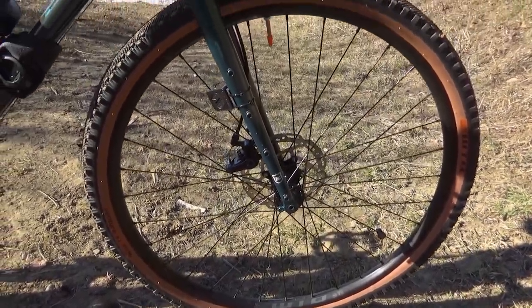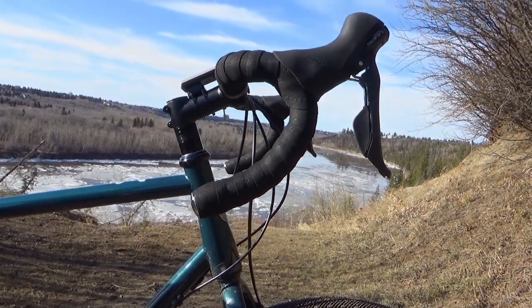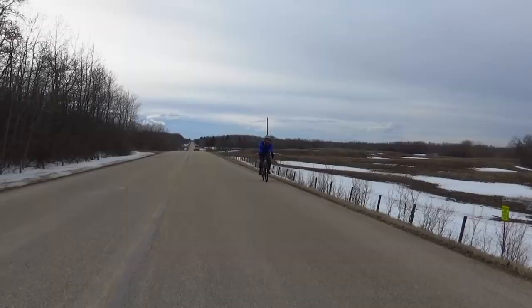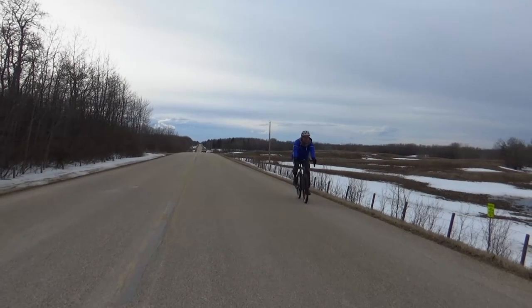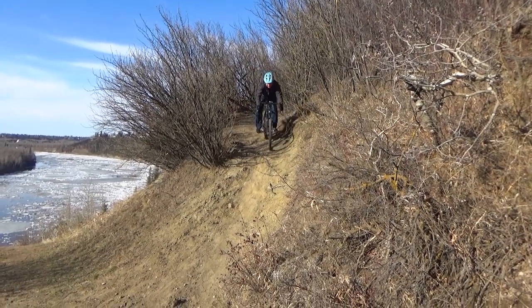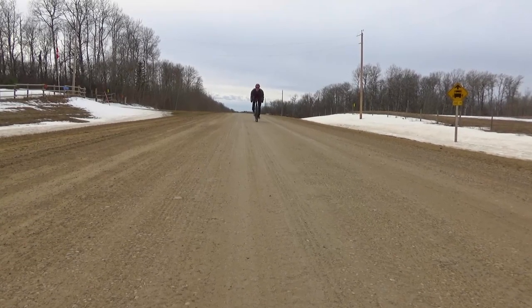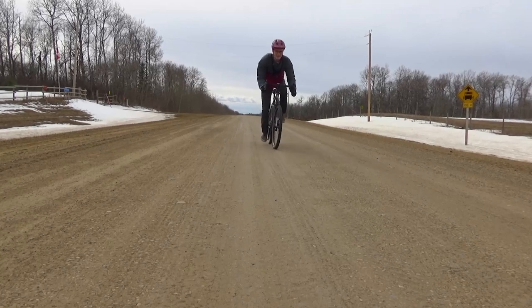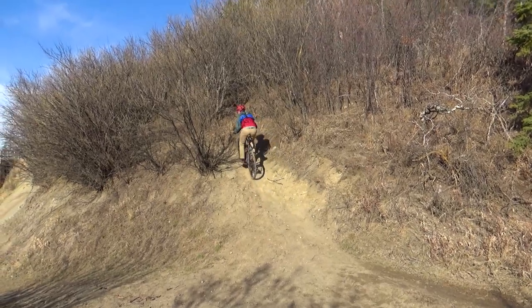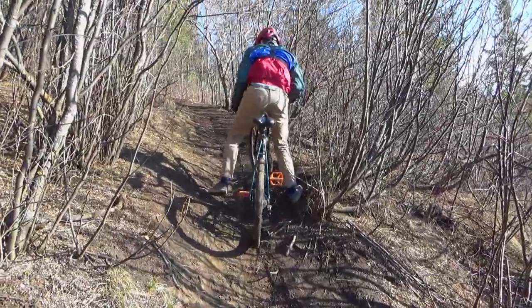If you were planning on using the Rove as a bikepacking bike — which it would be great for — it's even better because of the mounts. There are a ton of them on the bike, so if you want to put bags or bottle cages, you don't have to worry. As for the tires, as opposed to the standard 700c wheels on most gravel bikes, this bike has 650b wheels, which means a smaller diameter but allows you to run a wider tire and lower tire pressure, offering better traction on roots and rocks, though it's not quite as efficient as 700c for speed.